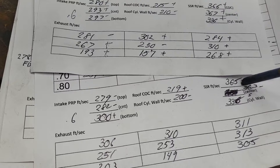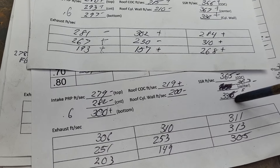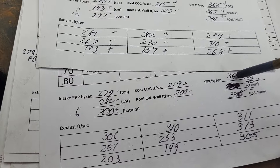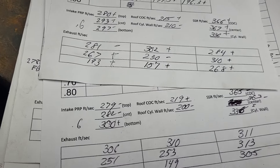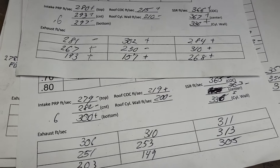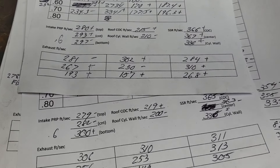Short side — I only changed one here, only went down a couple here, and this stayed exactly the same at 336. Our speeds from one side to the other are pretty good. If we had more metal we could probably do a little bit more to it, but I do not want to make a hole in these. Not really interested in ruining these heads — they have so many hours in them.